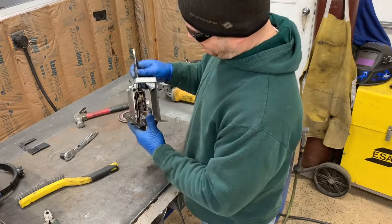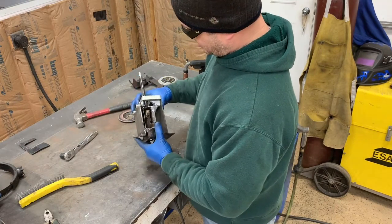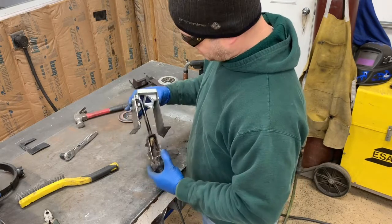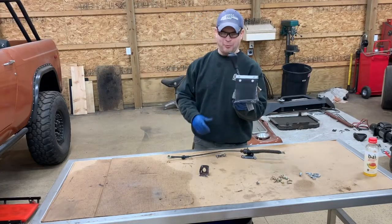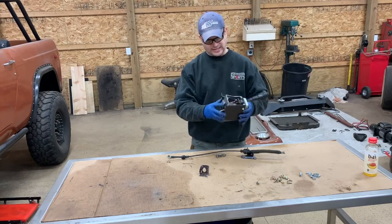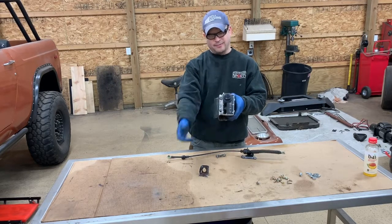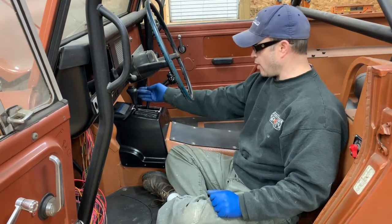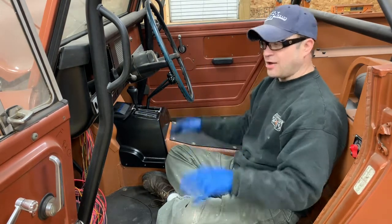So I don't know if you can see that. Now I have enough clearance. Now I can set the shifter, build my brackets, and hold this shifter mechanism in this housing. And I think this turned out pretty well, considering it was a big old honking unit, and I was able to actually downsize this entire assembly and make it work and keep everything working for a 4L60E. That's it. Twin stick, 4L60E shifter out of a 97 Camaro, made to work in a 70 Scout.